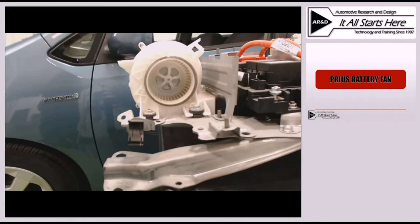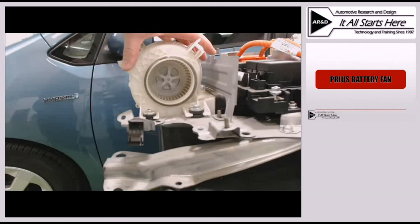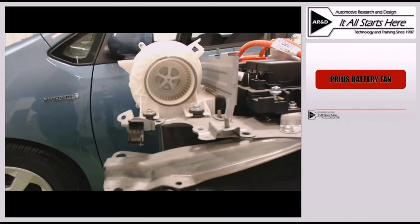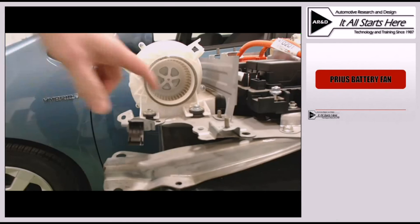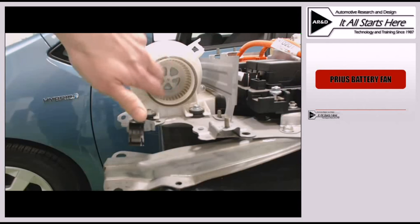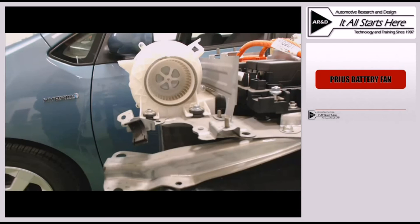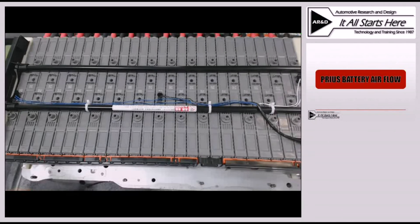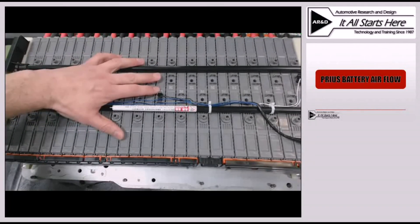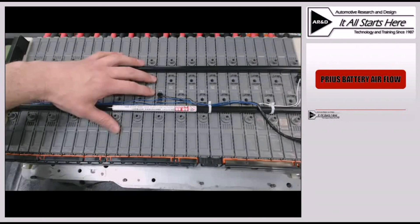This is a cooling fan out of a 2010 Toyota Prius battery pack — a squirrel cage style fan. You can see the fan blades inside and how they rotate. One area to inspect when working on one of these systems, whether Toyota or any other, is to make sure the fan blades have not become plugged with debris. This vintage of Toyota Prius in particular is seeing numerous problems with this — there are TSBs out including the availability of an inlet air filter assembly to install due to these issues. We also need to inspect between the battery modules themselves to make sure airflow can actually get between them, verifying there is no debris blocking airflow through the system.